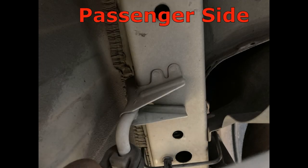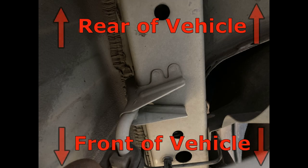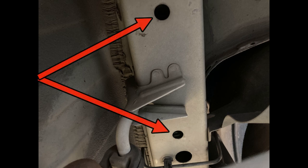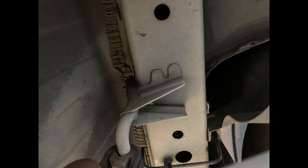As we begin to examine our mounting points, let's observe a couple of landmarks. This is the muffler brace and our two trailer hitch mounting points. Now, according to the instructions, the access hole for the passenger side rail is circled here. There's just one problem. About 2/5 of the hole is covered by the brake line.